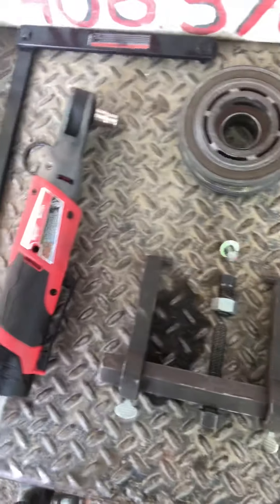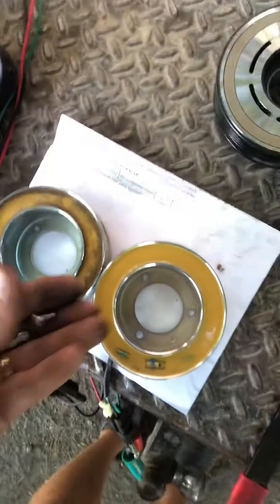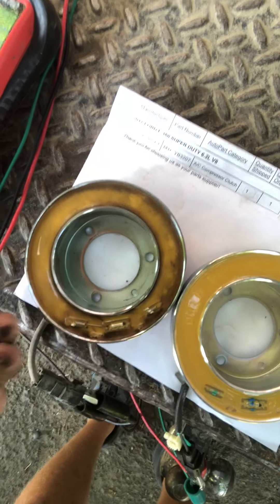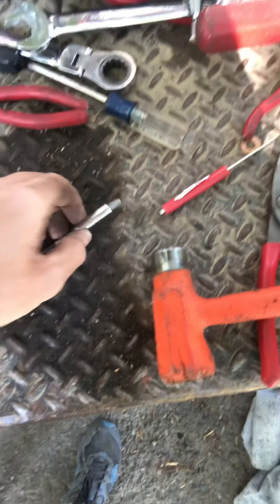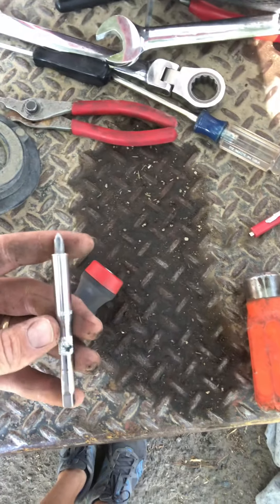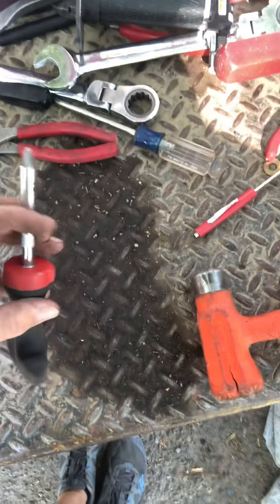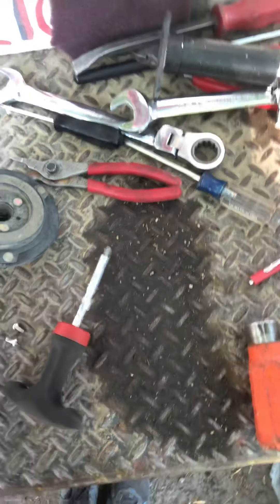So once I got that out, I was like, okay, I'm almost home. And then you call this Ford engineer up and slap him upside the head because he used Phillips screws to hold this coil on — not the coolest thing in the world. Luckily, they came off. This is a '17, it's got like 50,000 miles. I just used this setup, put this in there, hammered them all a couple of times, then cranked them down with my handy little gear wrench driver. Cranked them loose.